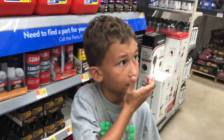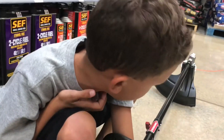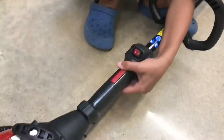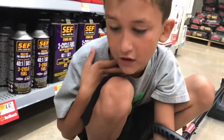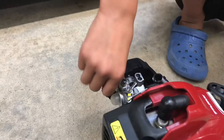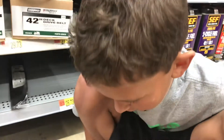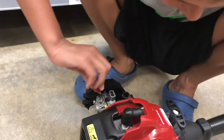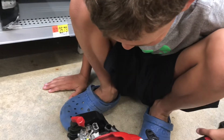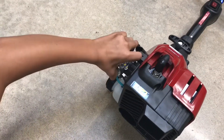Alright Aiden, tell them about that weed eater. This weed eater has the electric trimmer head — the head constantly spins while the engine is running. This one has a 20cc engine. Here's the power off switch. And this does have the magic choke. When you push in the primer bulb, it locks the choke in place. When you hold the throttle, it lets out the choke.